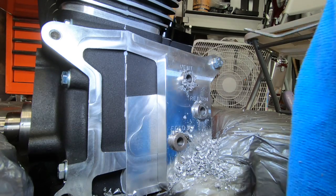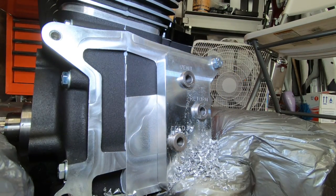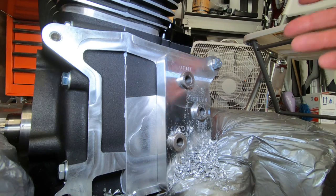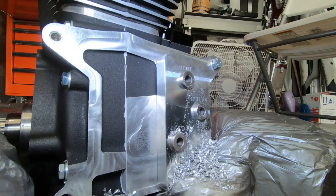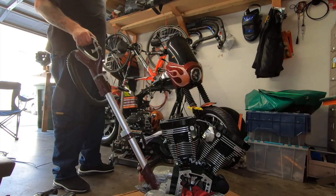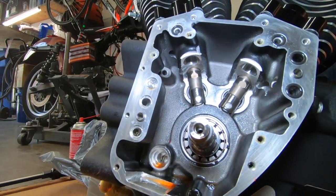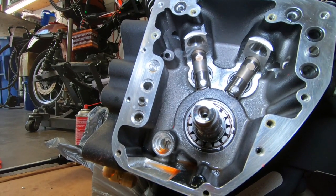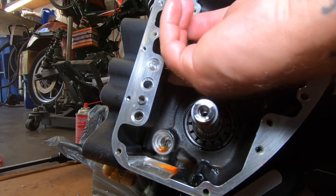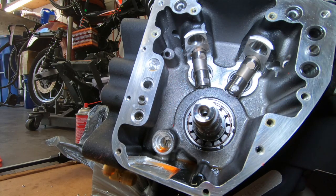Okay. So that one's in the cam chest here. Now I gotta clean up. I'm gonna vacuum everything out right now, vacuum up all this aluminum, and that's gonna be the next thing. So the passages look great. I would advise to check for burrs up here, because if one chips off, you know, it's gonna get down here. I have very little mess to clean up.